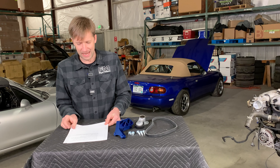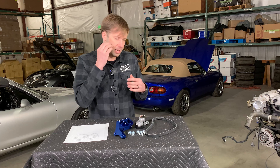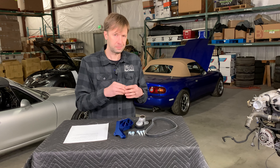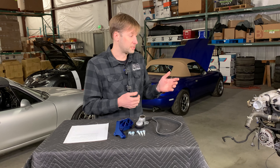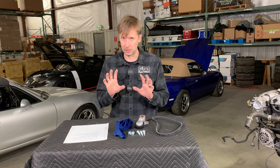Will it damage a power rack to run without the pump or power steering fluid? No, it won't. As long as you have some kind of lubrication in there so the parts can slide back and forth. When you do the depowered thing, we tell you to smear it with grease and do all that. Even if you just drained the rack and looped the lines, there's going to be enough fluid in there to provide lubrication. If you want to pull your belt off to see what depowered steering is like, you're not going to break anything, but the effort is going to be dramatically higher than it would be with a legitimately depowered rack.